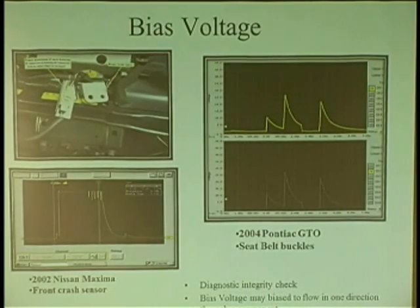So let's just do a little math. Let's say it sends 5 volts. So plugged in, it's 2.5. Shorted, it's 0. Open, it's 5. So the computer is monitoring that line all the time. Or just maybe on one key startup. You do a key startup, it does what I call touchy-feely. That's what it is. And it may do it for the first couple seconds.